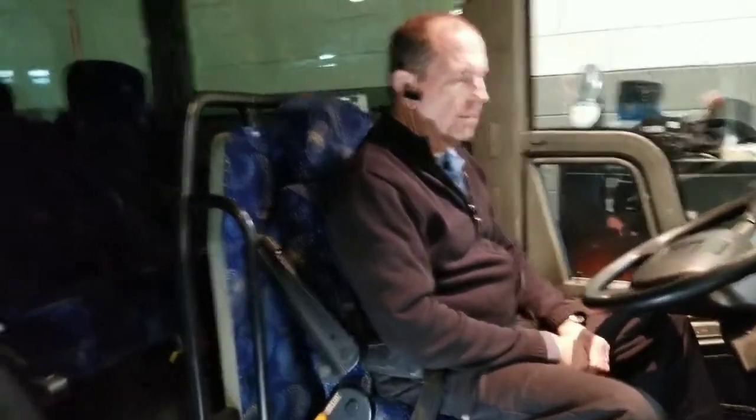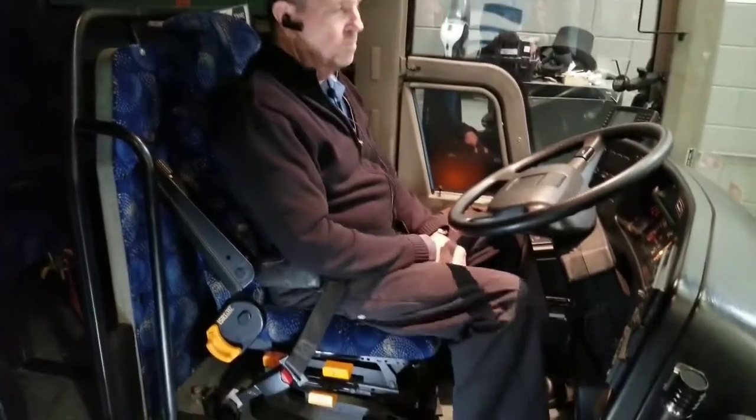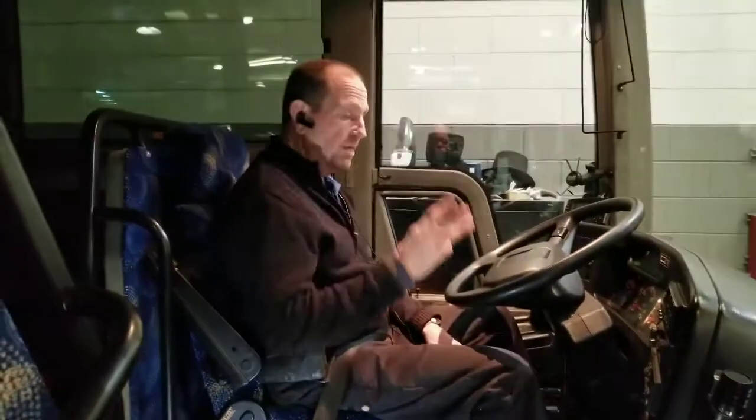You want to make sure you don't lose more than three PSI in the first minute. Now I'm going to place my foot on the brake pedal, push down like I would at a stoplight, and make sure that after the initial drop I don't lose more than three PSI.